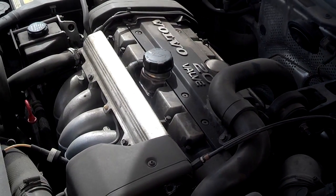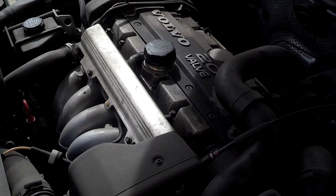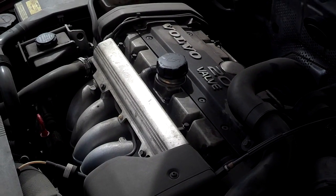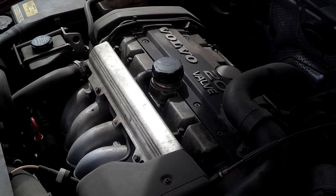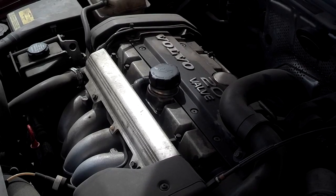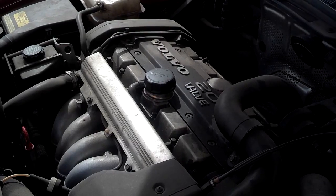In this video, I'm going to troubleshoot a misfire code on a motor as briefly and as detailed as I can. For a car motor to run and run smoothly, it has to have all of its cylinders working properly. It needs five basic things: number one, fuel; number two, air; number three, spark; number four, compression; and number five, timing. If your car is missing any one of those five ingredients for any of the cylinders, it'll misfire and won't run smooth.